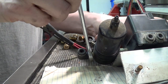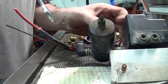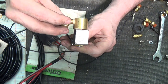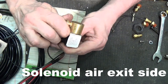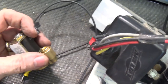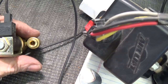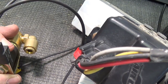I'll take off the air fitting on the manifold air dryer right there — this is the air filter that runs in front of the airlift manifold — and just put that one in place of the other. I'm going to put the smaller 3/16th fitting into this side of the solenoid. The savvy viewers will notice this is actually a push-to-connect fitting, which I generally hate because they leak. However, this fitting is DOT brake line approved, so if you're going to use push-to-connects, get a good one like this. It will not leak.